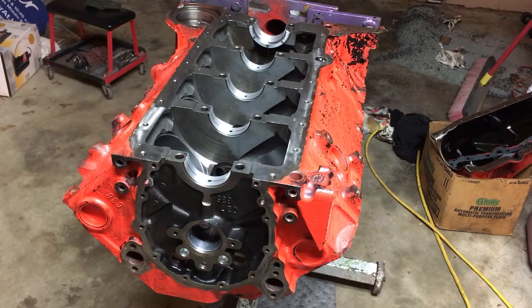the last time I went through it, and I absolutely hated it because it gave me way too much oil pressure, because this engine has really tight bearing clearances in it. Combine that with even a 10W30 or 5W30, the weight of the oil didn't really matter that much with that high volume pump and those tight bearing clearances. Cold engine, you're at 80 plus.